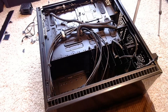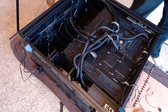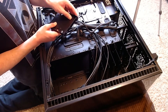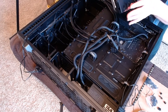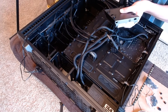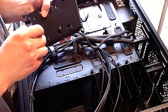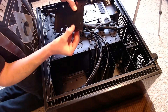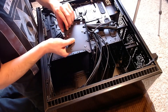Next, it's time to mount the hard drives. This case comes with six hard drive mounts with additional ones available for purchase. Just like with the previous case, these mounts use rubber grommets and four screws. The protection against vibration is important because of other hard drives in close proximity — imagine how much vibration can go through a case loaded with over 18 hard drives. After lining up the hard drive with the cutouts, I fasten all four screws. These hard drive mounts are secure and designed to be removed and installed easily. We install the vibration absorbing rubber grommets — there is a really satisfying catch after installing each of these.